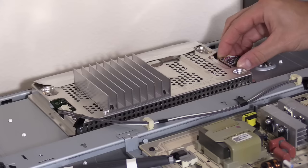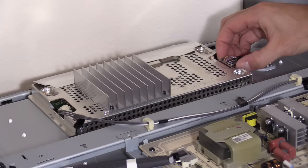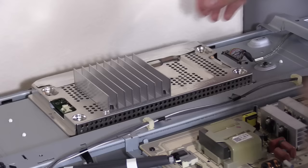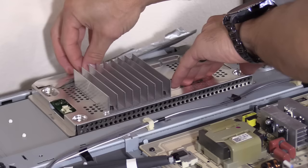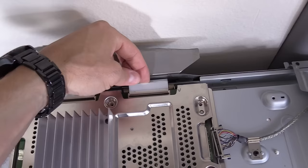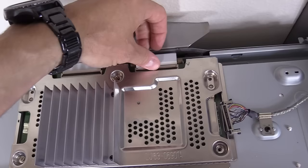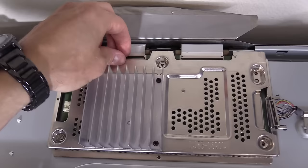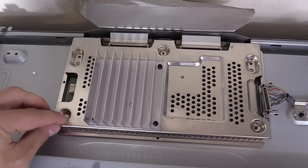What you want to do is squeeze the sides and pull this out. Never ever pull on the wires. This one you have to squeeze from the top, use your thumbnail and pull it out. And this one you have to peel up. You just get your fingernail under that and lift up. There's a little handle and you can pull that out. You'll notice there is a black line — that black line is an indicator making sure when you close that latch, it's flush with the latch, letting you know that the cable is plugged in correctly. Then there are screws here that you have to remove.